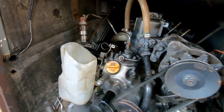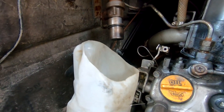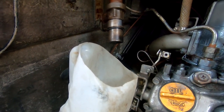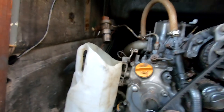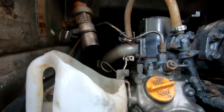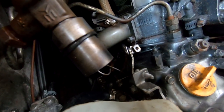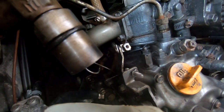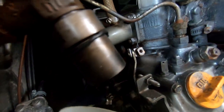Hey guys, this is my little GM10 on Snow Goose. I've just pulled the injector and turned it round so it's now spraying into a milk carton. I think it's squirting rather than atomizing, but I might be being a bit harsh on it. I'm going to try and get an angle where you can see it without me hitting you with a cranking angle handle. Not sure if you'd call that a squirt or a spray.